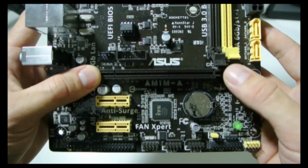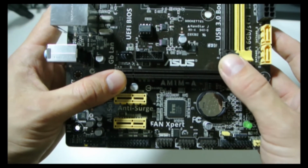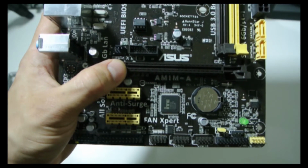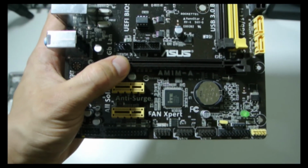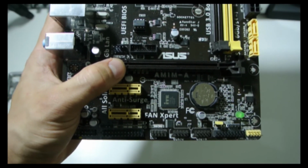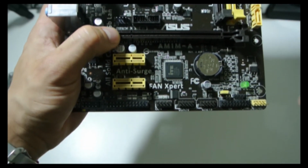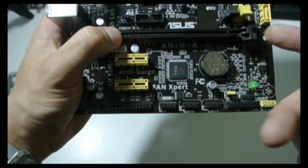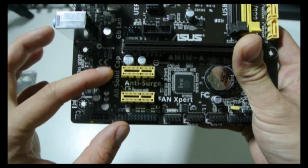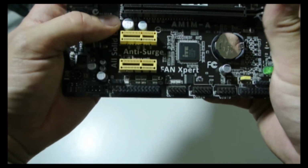Then you have a PCI Express. It's just 2.0, not 3.0, running at 16 but only 4 lanes, so you're not going to get full bandwidth from a graphics card. But take a look in the description, because there's a video that someone else has made where they've made a gaming PC based on this sort of setup, and you can actually get some really good frames per second on Advanced Warfare and stuff like that. So yeah, you can add a graphics card to this, you just won't get the full amount of its performance and bandwidth.